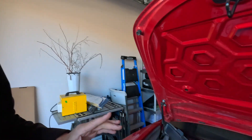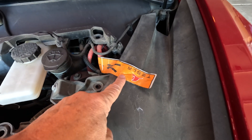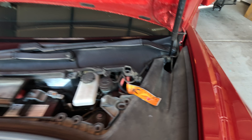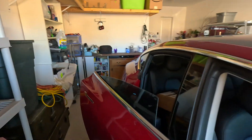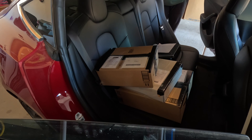We need to disconnect — just to be sure, for safety — we don't cut it, but we can disconnect those connectors. Then here, on the rear seat, you have to take some stuff out. There's a high-power voltage disconnect underneath the seat, and that's what we have to do as well. Take the rear seat high-power voltage disconnect off, and then we can get to the battery.